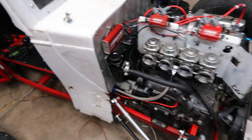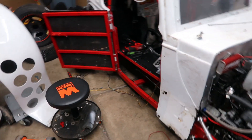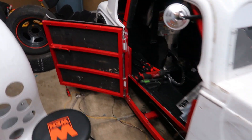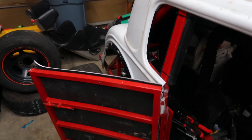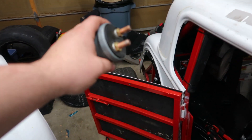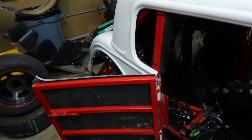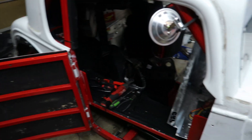Just a little bit of a mistake. Unfortunately all of the wiring is not properly labeled, so seeing that we got a couple things mixed up — we were also changing out our kill switch because the one that was in the car was just a two-pin one, and we obviously need a four-pin one so that when you kill the car it also kills the alternator with it.